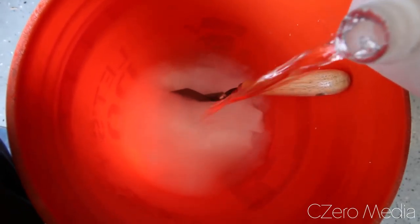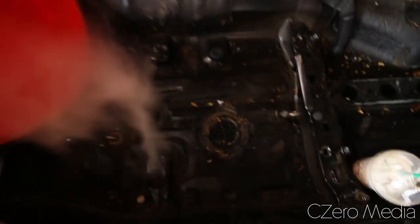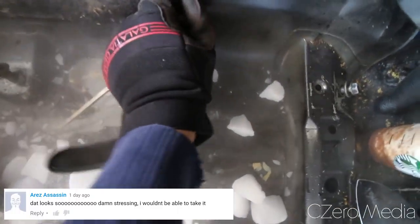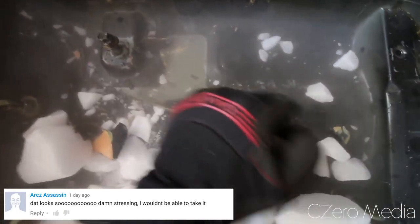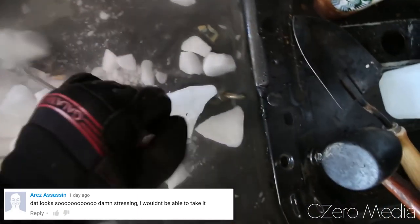I hope it starts breaking down. I don't even know how much to put in here, so I'm just kind of going by the feel of the dry ice. Getting nice and smoky. Okay, here we go. So after you sink your dry ice and it's kind of settled in there, you just want to grab a screwdriver — go in the middle there — or a chisel, and hit it with a hammer, and the sound deadening should technically come out.